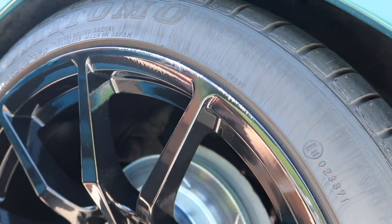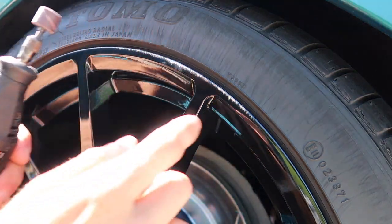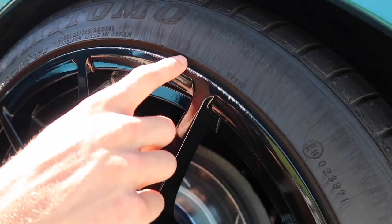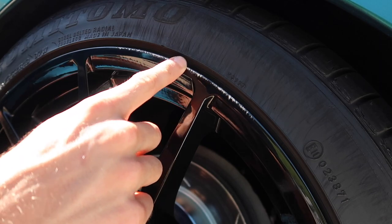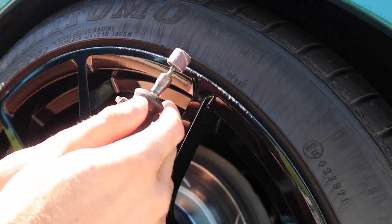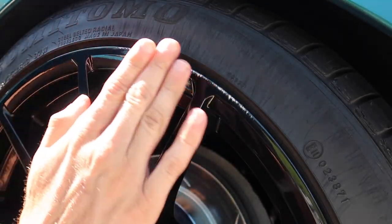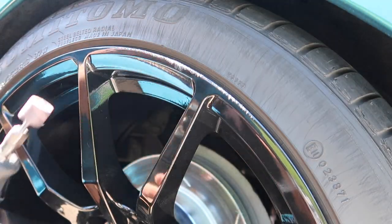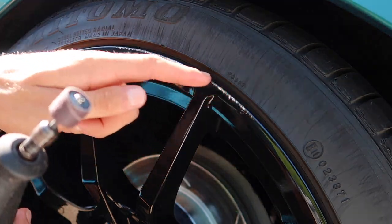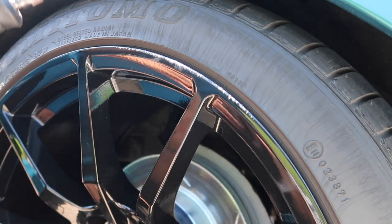The first cut is always what hurts the most. So what I'm going to do is go from about here to here. I'm not just going to stay in one spot and dig this stuff out — I'm just going to make nice smooth motions going back and forth, trying to evenly bring this down as flat as possible. I may not even try to get it all the way down to the very bottom, because then it might be noticeable how much of the metal is missing.